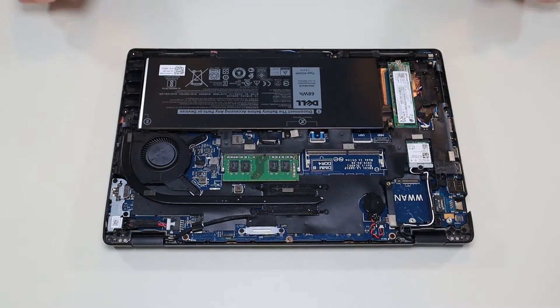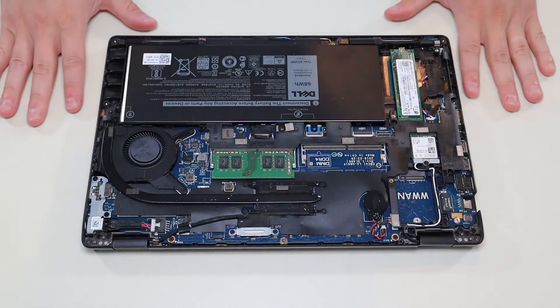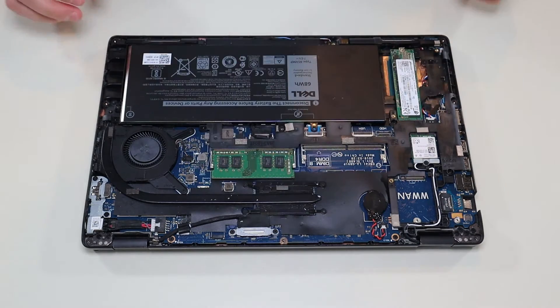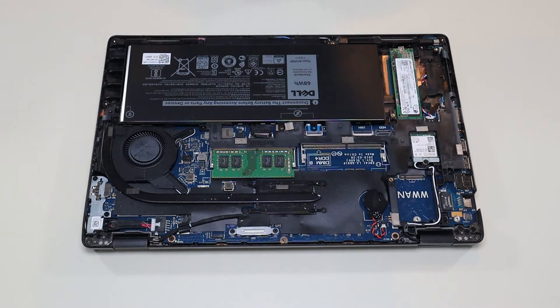And that's what you're looking at for the inside of your computer. As a side note, when I open up any computer, I have it sitting on an anti-static pad — either that or an anti-static bracelet. That'll go a long way to avoid damaging anything when you're poking around inside. If you need help with any tools or supplies I'm using, there'll be a link above and also below in the description to my Amazon store.